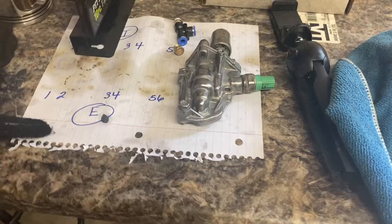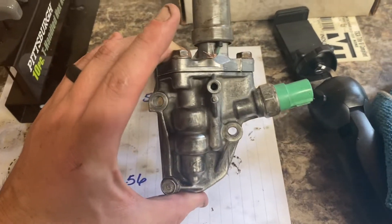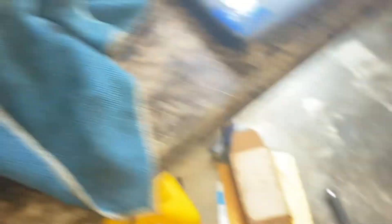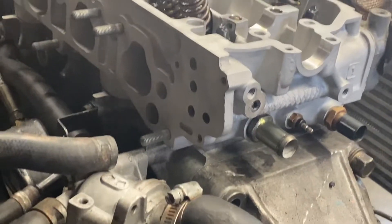We've got everything cleaned up and the head looks great. I got a lot of the little fittings put back into it earlier today, the water neck back on, and we're actually waiting on a VTEC solenoid. The previous head that was warped was a D16 Z6 head, but the head we got is a D16 Y8 head. The pattern and the VTEC solenoid is completely different — this VTEC solenoid here fits the D16 Z6 and will not fit the D16 Y8 bolt pattern.